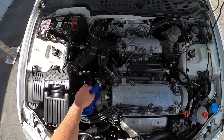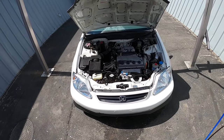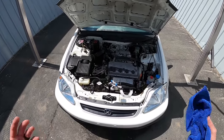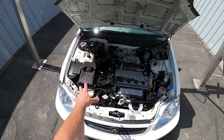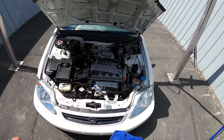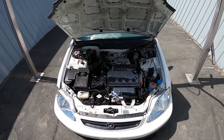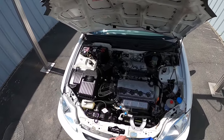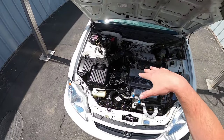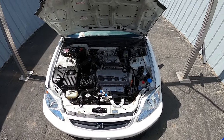Hopefully you found this information useful. If you're using that much water, be careful — make sure you're not spraying into areas that don't need it. Mask off your distributor and any other sensitive areas and you should be totally fine. Depending on what cleaner you use, also make sure to rinse off your panels — a lot of that cleaner will fly out of the engine bay and land on your fenders, windshield, hood, and bumper, so rinse those areas and wipe them down so they don't ruin your paint.